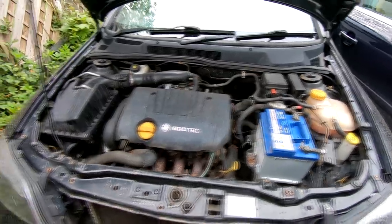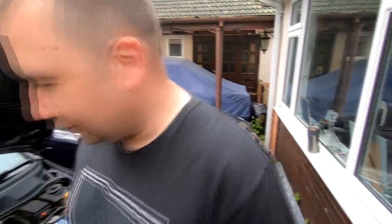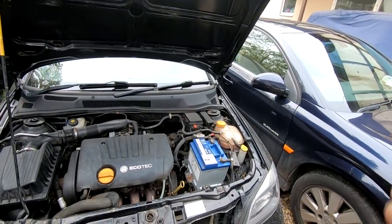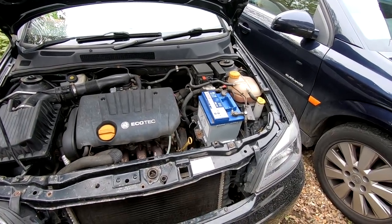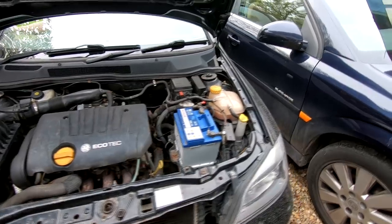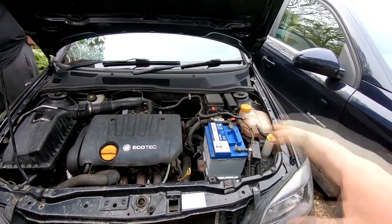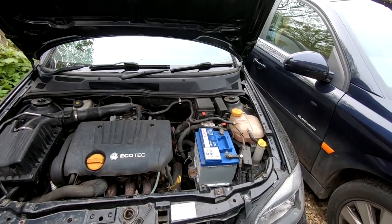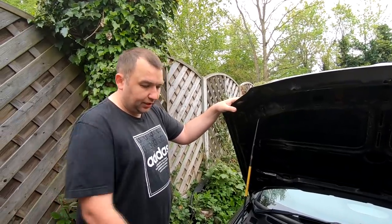As you can see, it's a nice quiet engine. Just put it in gear - put it in fourth gear and put the throttle down. I was going to say, just put my tea down. I ain't even got time for a cup of tea! We thought it was clutch initially, but it sounds like a gearbox problem to me. He's going to put it in gear and drive off. There you go - so that's the noise we're getting. The clutch isn't slipping, the clutch is actually biting, and it does it in every gear. You can drive it along slow and then suddenly it will slip. I thought the clutch was breaking down, but that doesn't appear to be the case. The gearbox is going to have to come out. He's sourced another gearbox for it already from a breaker.